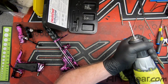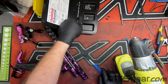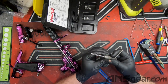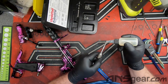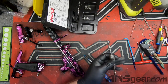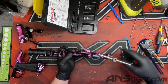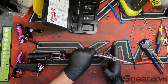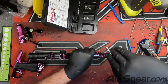That's it for drilling out the threads. Now we're going to use our tap — I'll put the other tap aside so it doesn't get confused. I'm putting this into a T-handle so it'll be easier to turn, and I'm going to use a little bit of oil on here so it doesn't bind up. We're not making huge thread changes — we're just making room. We're going to come in straight from the top, and it is important that we go in straight up and down on both our X axis and Y axis, dead center.